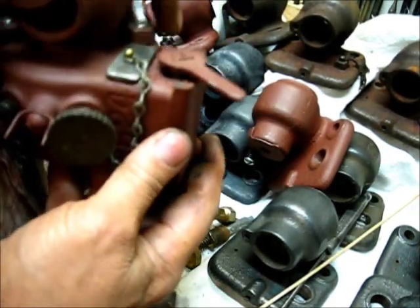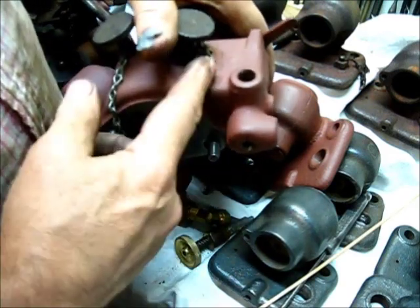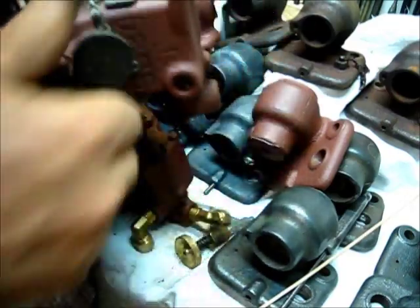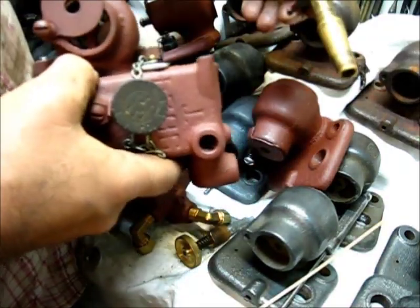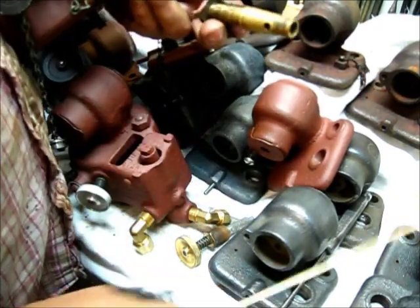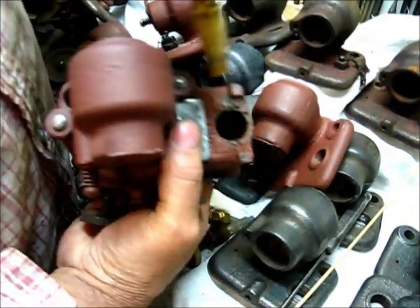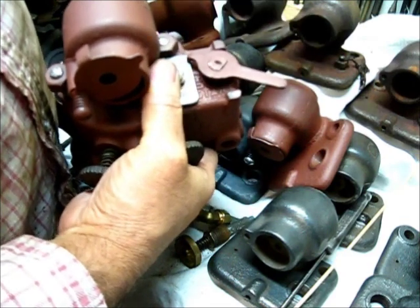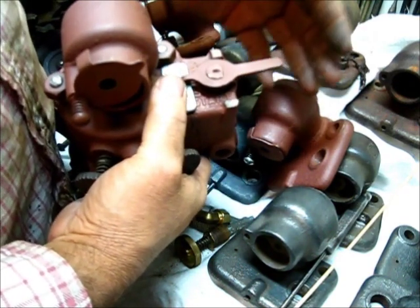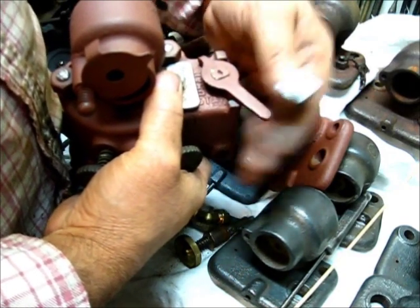You'll quite often find these that are just stuck and you think you're going to have to disassemble the carburetor to the point of drilling a hole in the bottom of it, right in the center of that taper pin shaft. It's got a hole in the side here and a hole in the bottom that lines up. When you look down in that hole and put this in there and turn it, that hole lines up and the mixer will drain back to the fuel tank. Turn it to where the run position lines up — that's the run position.